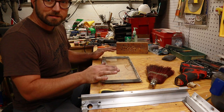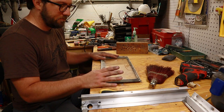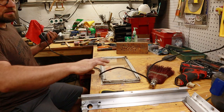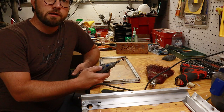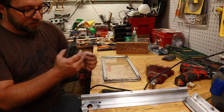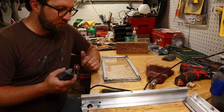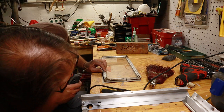we need to get the glass out of the little window pane and clean that up. We're going to cut them open using our Dremel tool. The place that I bought my gaskets from, VintageTrailerGaskets.com, recommends doing it this way. They say if you use a screwdriver to pry them open, you'll just deform the rail and cause problems. So this is how we're going to do it.